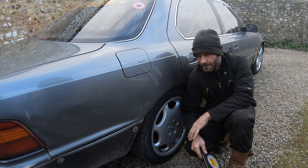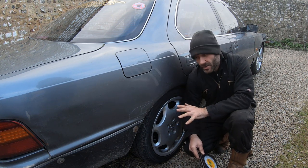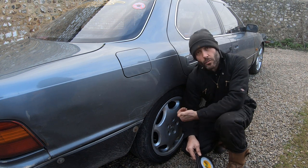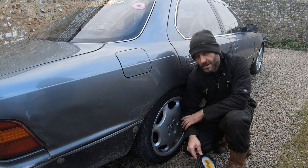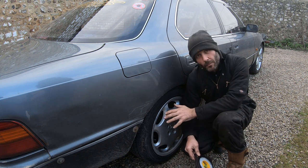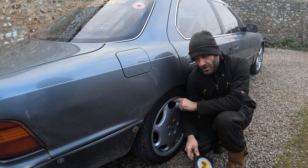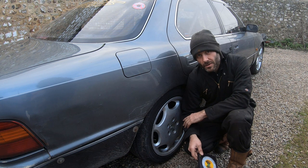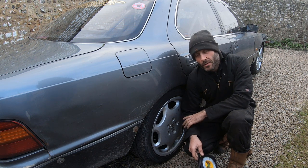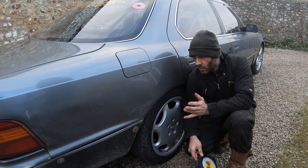The car's just sat here, and when the car squats that gets even worse. Usually for drifting, drag, traction — everything else — you want maybe a quarter to half a degree of positive camber on the rear wheels when it's sat like this, so when the car squats they go perfectly straight. That gives good even tire wear and maximum footprint onto the track. On the Lexus that's not adjustable with the arms we've got — I can't adjust it far enough out and the bolts are seized. This is going to be a nightmare to get out, but once they are I'm going to make some adjustable arms so we can adjust the toe and camber to whatever we want.